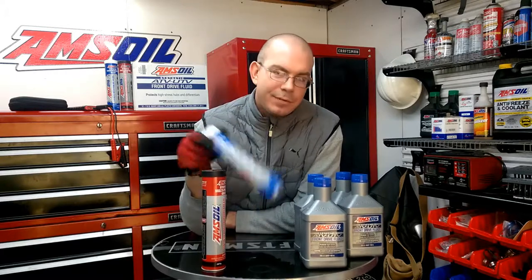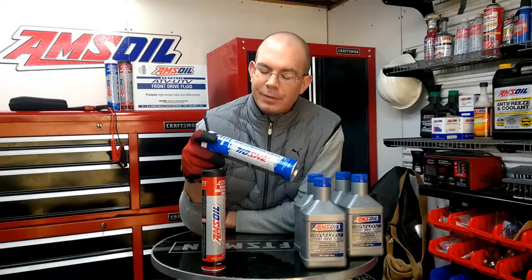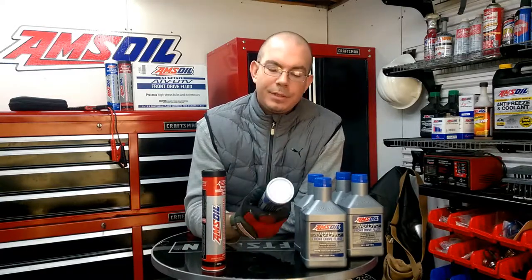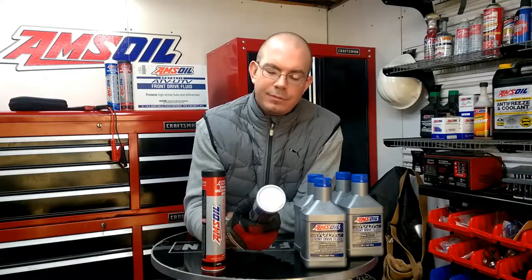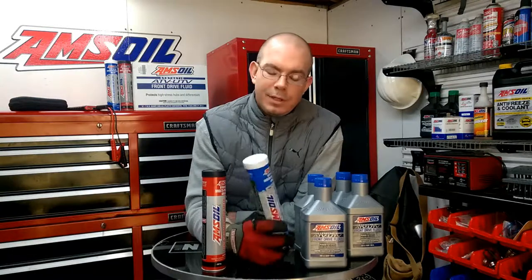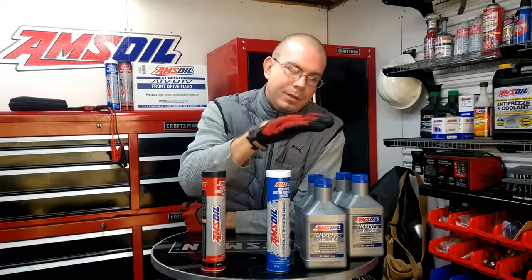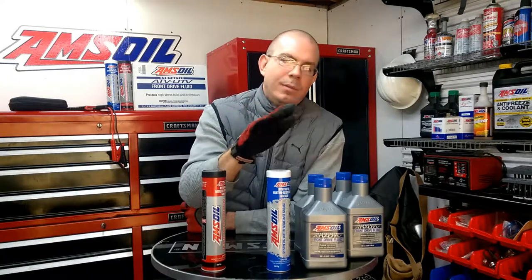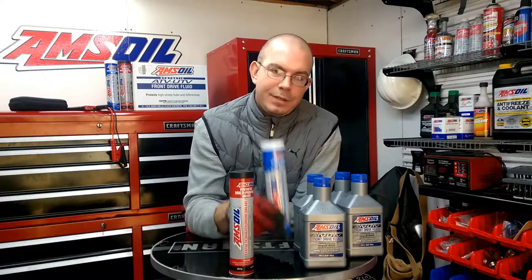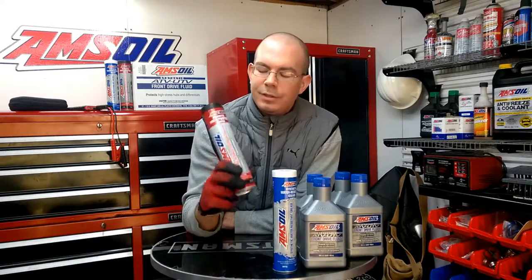Back to the grease — if you have grease zerks and you're riding creek bottoms, this water-resistant grease is killer and it's not very expensive. It's also great for boat trailers since you're putting the trailer down in the water; you need a waterproof grease. Don't buy cheap grease for your boat trailer bearings — nobody wants to tear apart a boat trailer any more often than they have to. If the specs on the waterproof grease don't match your application, note that you really don't want to mix incompatible greases.